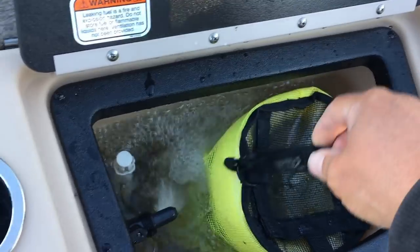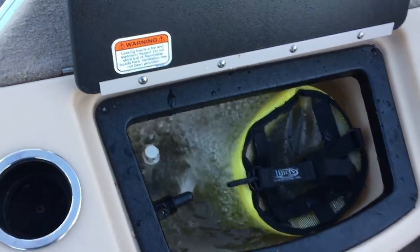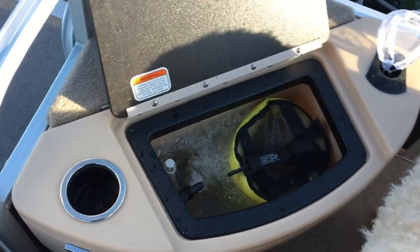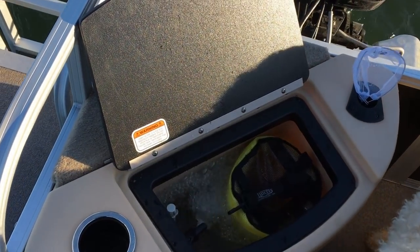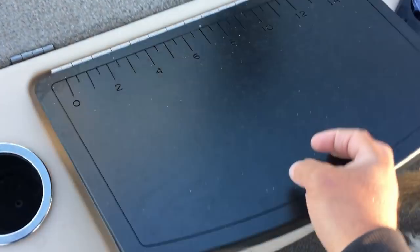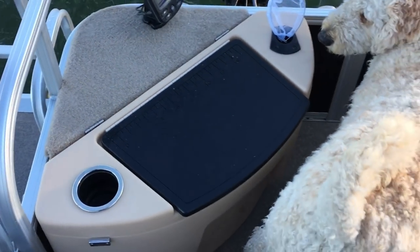There's a petcock on the water coming in there that works really well for shutting off one of the live wells — you'd never shut both off. It keeps them aerated very well and recirculates nicely. You can have it running when you're moving slowly, but never have the pump going when the boat's going fast.